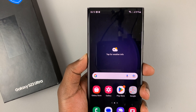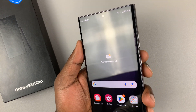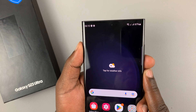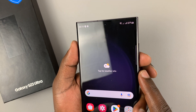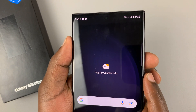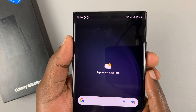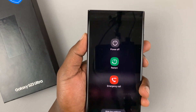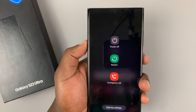That's one way to switch off or restart. Another way is by pressing and holding the side button plus the volume down button on the phone. The side button is also the power button. Press and hold these two buttons — if you press once and release it's going to take a screenshot, so press and hold. The power menu appears and you can now either switch off or restart your Galaxy S23.